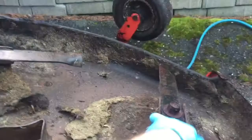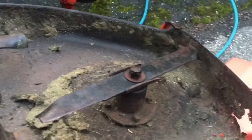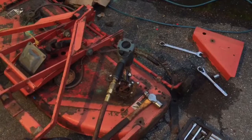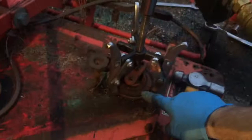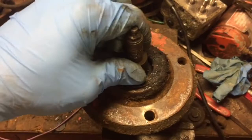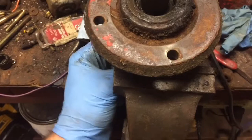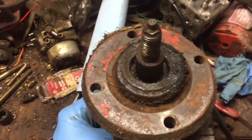The problem at hand is the spindle. I'm going to attempt to get the spindle off - probably all four of those bolts are going to snap off - but I'll fire up my compressor and get my impact wrench out and we'll go from there. Got the blades off the bottom of the deck, and now we have to use a puller to get this pulley off the actual spindle. I'll do that off camera. Got the spindle on the bench now - something's binding in there, it doesn't want to turn easily once it gets to a certain spot. It might be bent a little bit. Look how much play there is - there's a lot of play in this thing.